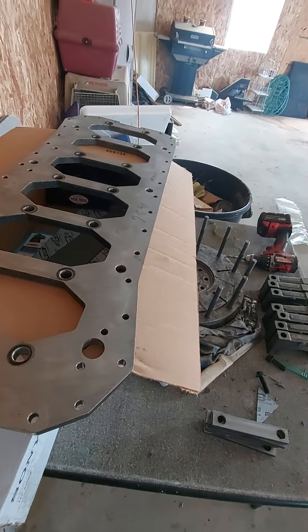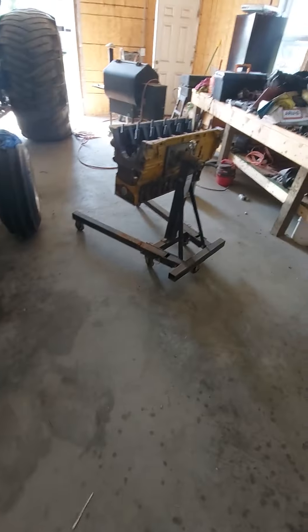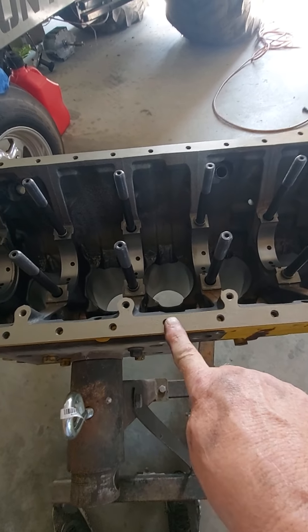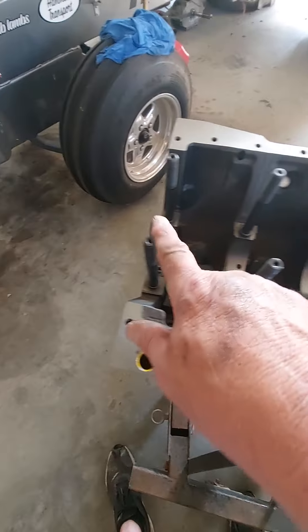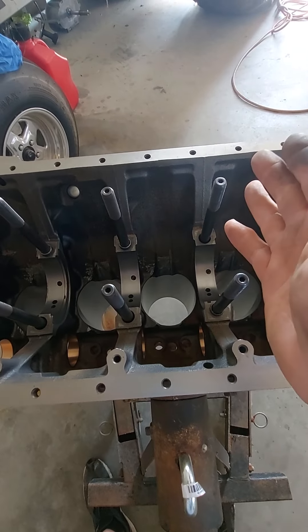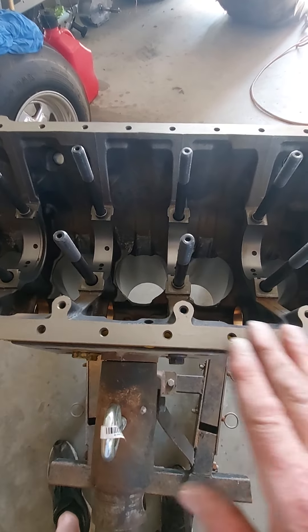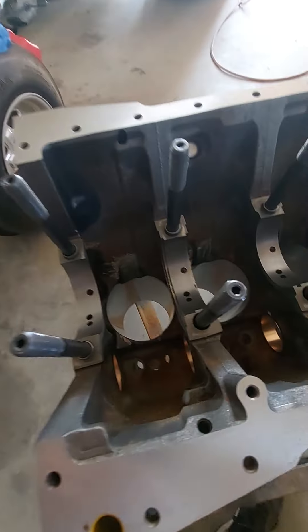So when this goes down on top of that motor, those main caps are flush with the pan rail. We tighten this down to 150 foot-pounds on these mains. What happens is these caps want to walk when they're under extreme load and pressure — they call it cap walking. By doing this we're crunching everything down tight and securing it to the outside of the block, which ties everything together and gives you a much better base.